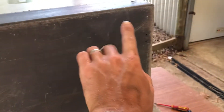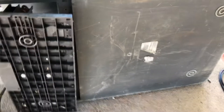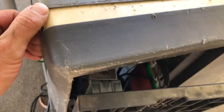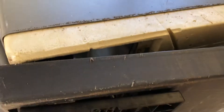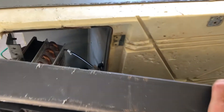There's another screw there, there, there, and there. Once you've got them loose, get a little screwdriver — I've already started prying it — and you literally pull it away from the actual fridge itself. I've already loosened this; it's a bit of a pain to get apart, but with patience you'll get it. Then that will pull out along with this — see how much give you've got here, just don't push it too much.